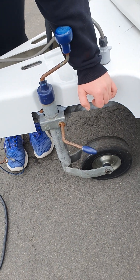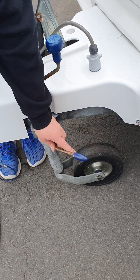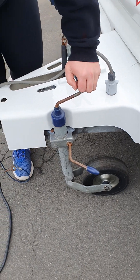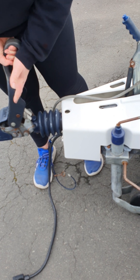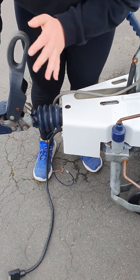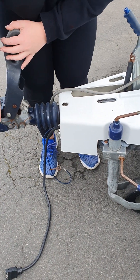When you go to disconnect the van from your vehicle, you'll want to do that in reverse — undo the jockey wheel, drop it down, tighten it up, and wind it up. While you're winding the jockey wheel up to get the hitch off, you do need to hold this handle all the way up so that it will release the tow ball. We'll run through that when you collect the van, as it's a bit easier to show you when you have your vehicle there.